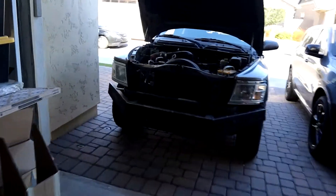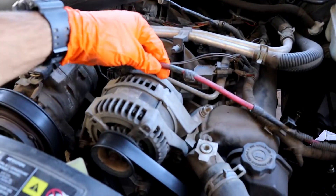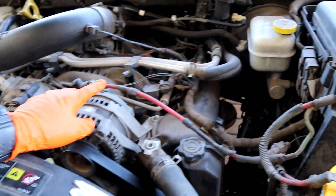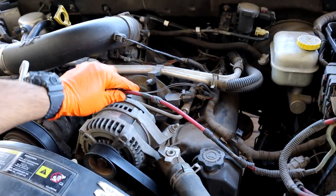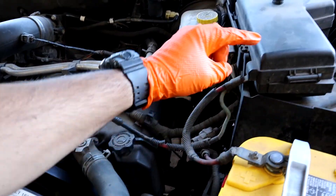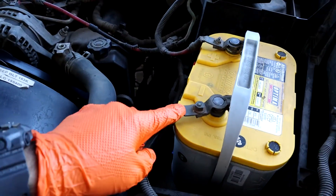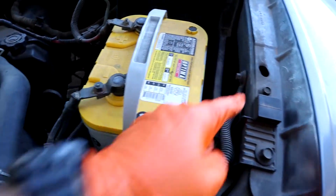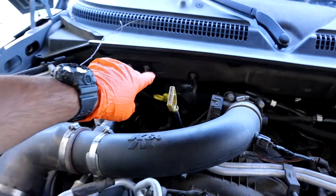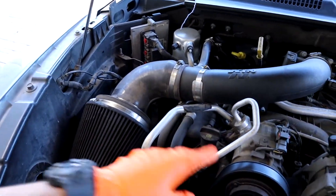I have a 2008 Dodge Dakota 3.7. So we're replacing this wire here — as you can see, this is probably like an 8 gauge or a little bit thinner than that. Here is your fusible link, goes into my fuse box. Power goes to here, then negative goes to my chassis here, and then I have an engine strap back there. I think I want to probably leave that one alone and tie off somewhere over here.